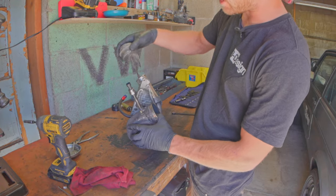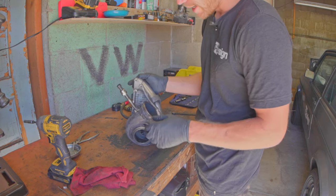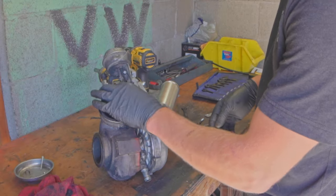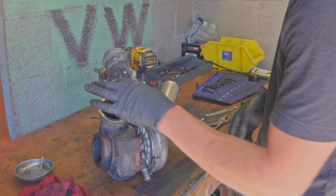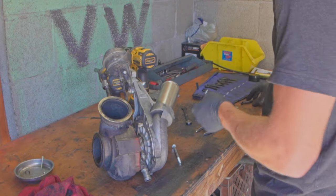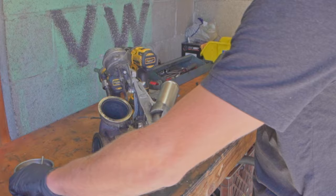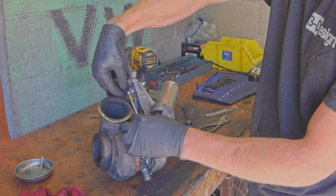This thing is really starting to look like an experimental turbo - we've got all kinds of weird stuff attached to it in all kinds of places. I'm just going to leave it right there, and on the next round when we put the ALH in, I'll buy a new center cartridge and clean everything up a bit more professional. This already has a very nice adjustment mechanism on it, so I'm going to leave that on and put it in the middle of its travel so I have adjustment. Then I'm going to take my old linkage fitting, cut the head off this bolt - all I'm really after is a thin shaft - and offset it a little away from the flange.